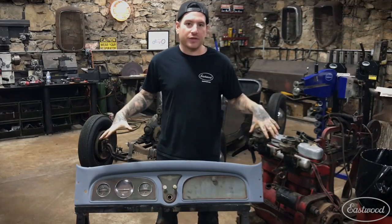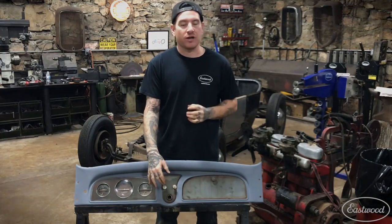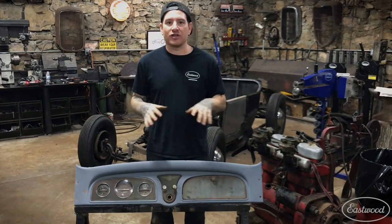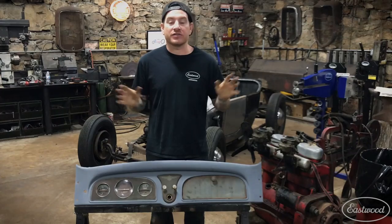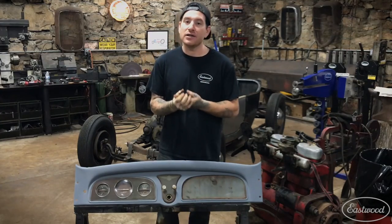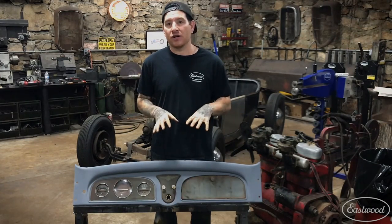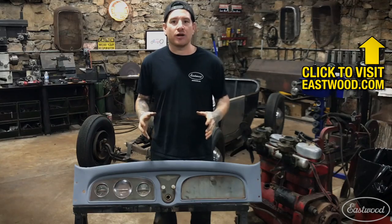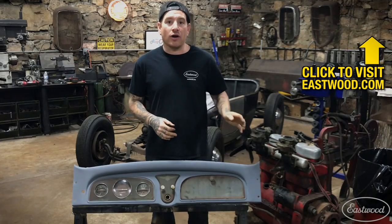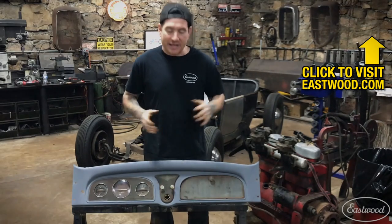I got the primer on, let everything dry overnight, and went ahead and threw the glove box, the gauge panel, and the center trim that holds the ashtray, light switch, and throttle pull back on — got it all mounted and it looks really good. The before and after on this is amazing. I can't believe it's the same dash. It's all sealed up — we used the blast out of the bucket small job kit to get it blasted down to fresh bare steel, then coated it with primer so when I'm ready to use it I'm not dealing with rust. We can go ahead and either spray a coat of high build primer or modify the dash as needed if it's going in a hot rod or something like that.